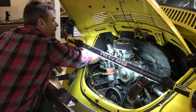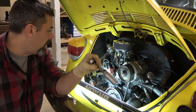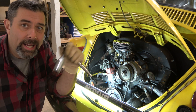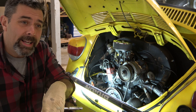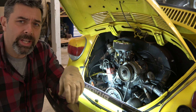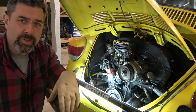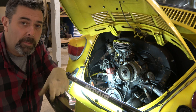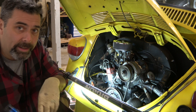When I start taking my spark plugs out, I'm going to inspect the plug ends. The spark plugs themselves, if they've been in there long enough, can tell us a lot about the overall running condition of an engine. If they all look the same and they all look like a light brown, that means the engine is combusting properly with a good air-fuel mixture. If they're all really black and sooty or oily, the car is running rich or we have oil getting in. If they're whitish, the engine is running hot, probably running lean.